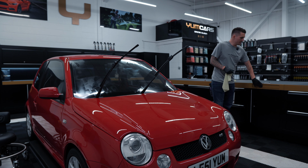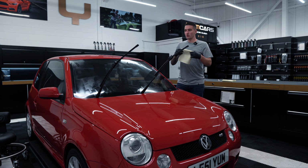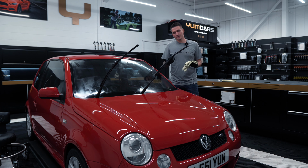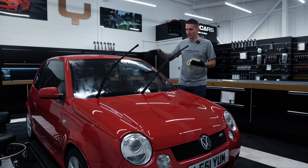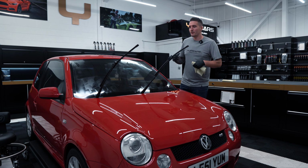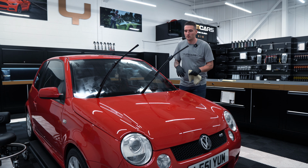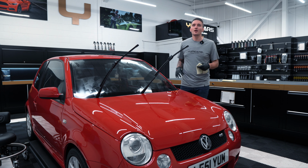Heavy alcohol-based cleaners, again, they'll wipe this off no problem, but currently the Glass Plus is at its most vulnerable state. The solvents haven't had the chance to gas off overnight. Obviously you've put no toppers on, stuff like that. So right now in the unwiped state, it's like a newborn baby, very easy to attack. To remove it, a full 100% removal will still take a little bit of effort, but still not as much effort as what I've gone to here in terms of polishing.